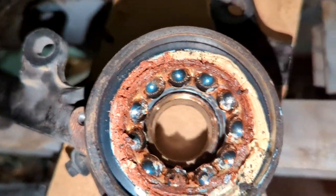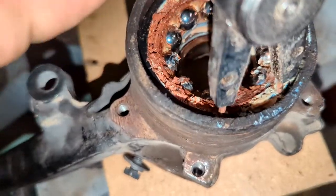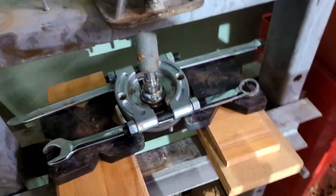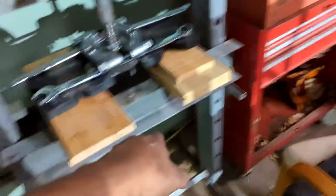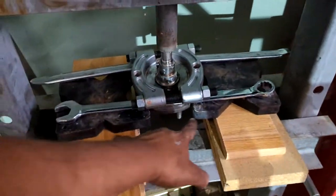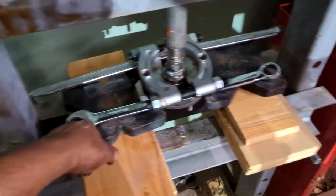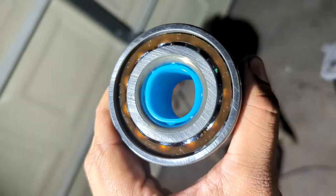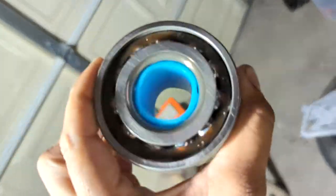So if you look around here, you'll see a little black ring — that's a snap ring. That little thing has to be pulled out. So the bearing race is out right there. Now the plan is just to push the whole thing all the way through. This is how I did it earlier — they actually pushed this part out of the hub assembly. I had to stack it up on blocks of wood because the actual hub section is too large to fit through the hole. But then when I placed these two on here, it would keep pressing down. So I used this wrench and that pry bar to distribute the load. I can see some white grease in there, so I'm guessing this is pre-greased.